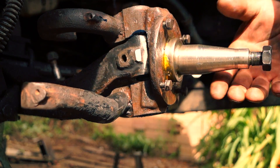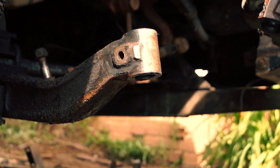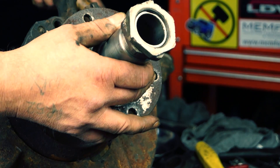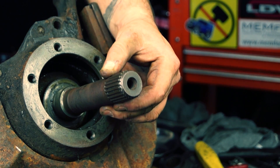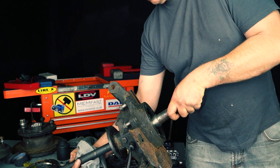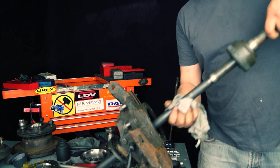This assembly is fairly common on an HGV or older vans with a beam axle. With the stub axle removed, on our housing here for Land Rovers, we have a CV joint inside. This is a difference because Land Rover has a live axle, which means that you have to run the half shaft through with a CV joint to be able to get power to your hub and turn your wheels.